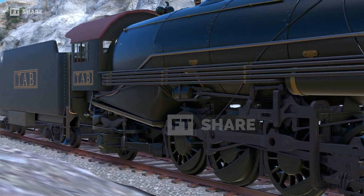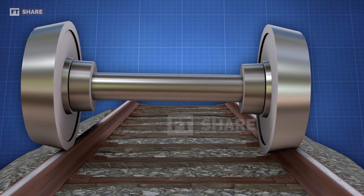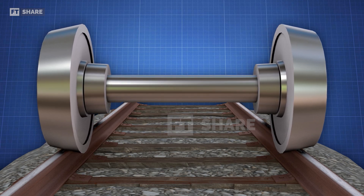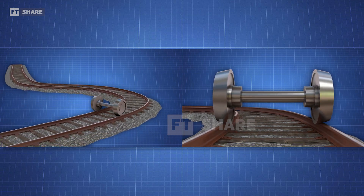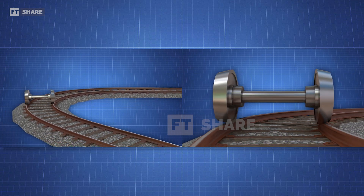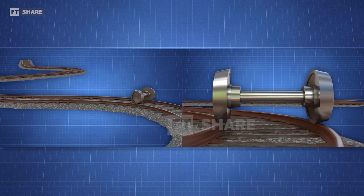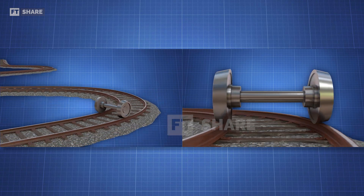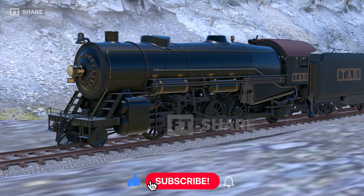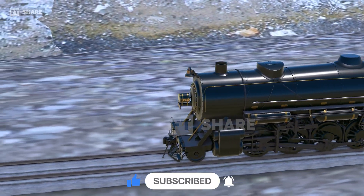Isn't that interesting? Of course, when the wheel shifts to the left, it automatically generates a force to the right, as we've seen before. During a turn, this force creates the centripetal force needed for the turn, so the wheel won't shift back to the center during the turn. And the same goes the other way around. That's a wrap on the discussion in this video. As usual, if anyone has any suggestions or feedback, please feel free to leave a comment below.